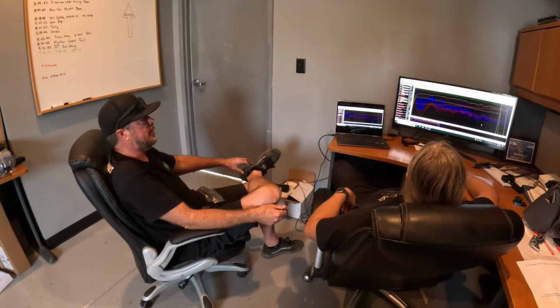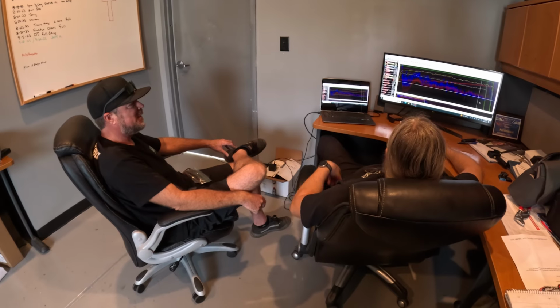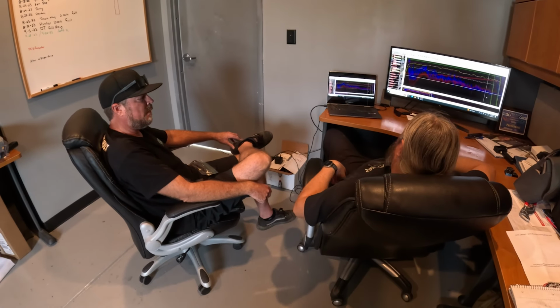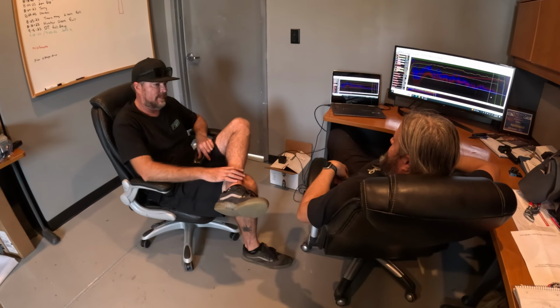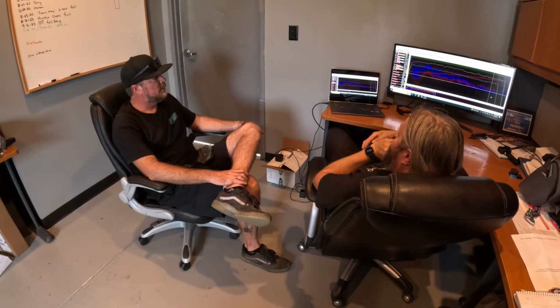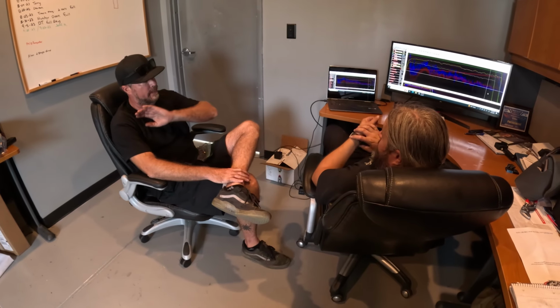I have no idea. Well, Pete has a pretty good idea because he does this. It's honestly probably fat. A lot of times I'll target 6.5 or so. But we're at 30 pounds, or more, right? So at the track, it's probably really on the fat side. And we can pull some out and see what happens.